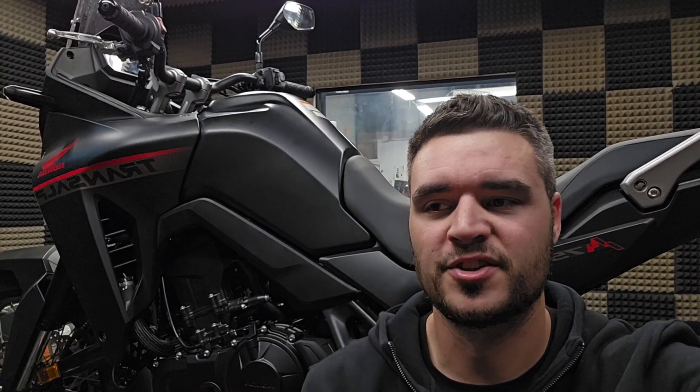We've also done some other stuff off camera. We went ahead and put the stock muffler back on our Acro headers, because more than one customer emailed us saying they'd obliterated their stock headers and now have aftermarket headers with the stock muffler — asking if we have mapping for that. The answer is yes. We took the time to build that combination since more than one person asked. It's really easy to swap out the exhaust systems on these bikes and truly doesn't take long to tweak the fuel mapping now that we've got everything built — maybe 30 minutes of work on the dyno. So if there are any other one-off or weird exhaust combinations out there, don't hesitate to email us and ask — the answer is probably either yes or yeah, sure, give me a day or two.